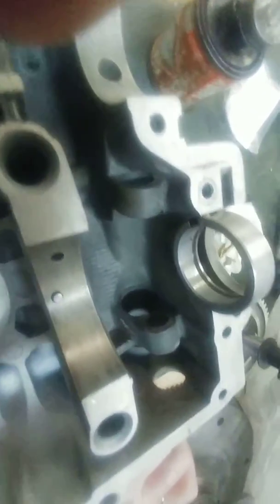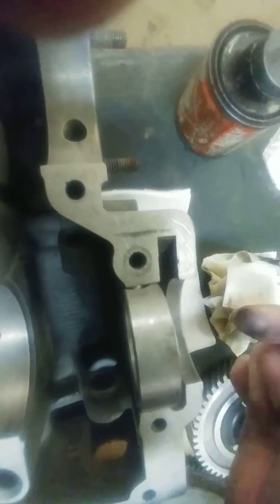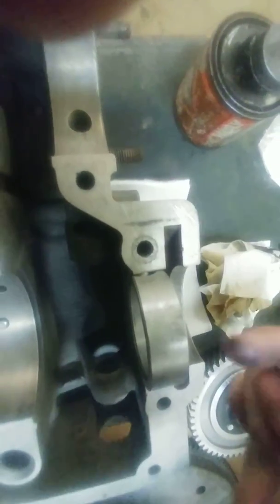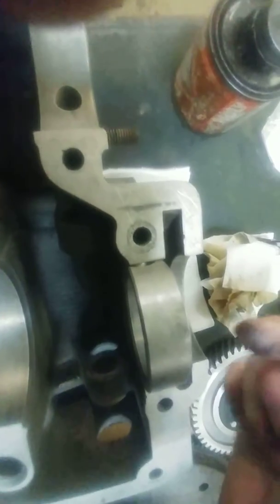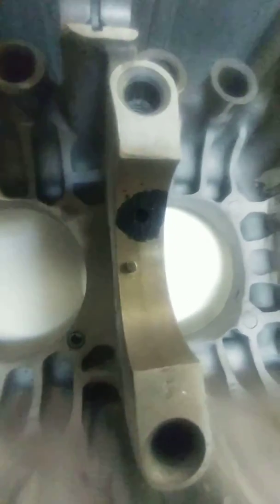The annulus groove also accumulates oil to drain it back out through that hole, to keep it away from the front slinger which is doing all its work to keep the oil back. They built that in as a manufacturing design to restrict the amount of oil there - so we're not going to touch that one, because we don't want more oil there or we'll end up with oil coming out the pulley. Just another thing to look at when building up high-performance VW engines.